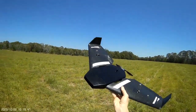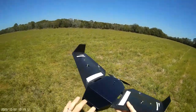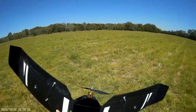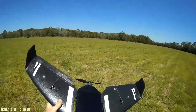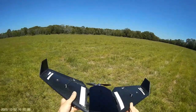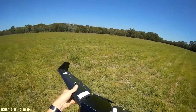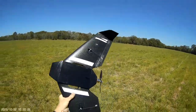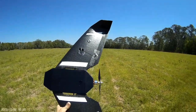I've got a custom-built fuselage here. I've gone for the big wide-mouth intake — air goes straight through, around the battery, over the ESC, and it exits at two big vents at the back. Last flight was mainly half throttle and none of the components were even warm — not even the motor, not the ESC. So the flowing-through cooling system definitely works. It weighs 585g and was very fast.